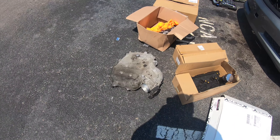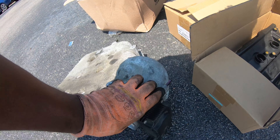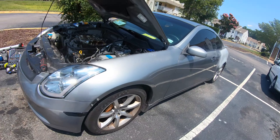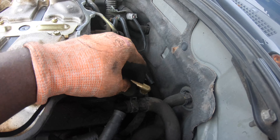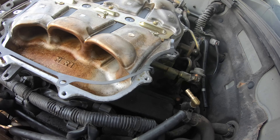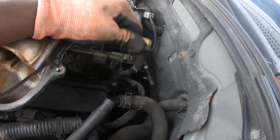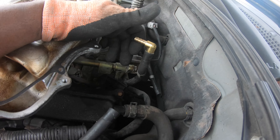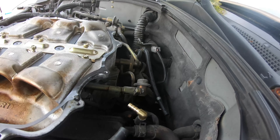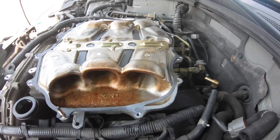Here's what I was talking about — you got the hose on the back of the throttle body and the coolant hoses going in and out. Those hoses connect to the brass fitting I mentioned. I'm not going to plug it up right now because I still have to do the valve covers. So just hook up the hoses, put the clamps on, bring the clamps back up and that's that. Now I'm going to take these six bolts off for the lower plenum and take that off because I'm also doing the valve covers.